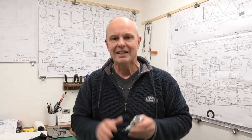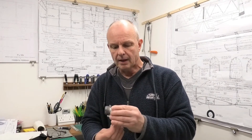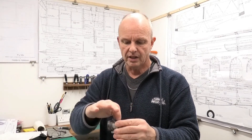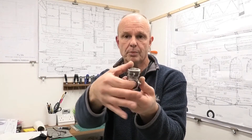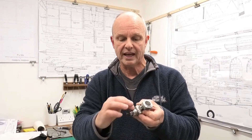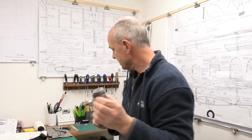There are four basic things we have to consider to get the timing done just right. The first is that the crank pin needs to be right at the top of its cycle — at top dead center — and there's a really easy way to hold it there. A lot of the bigger OS engines and newer ones have a T on the prop driver, but this one doesn't have any kind of mark to indicate where top dead center is.